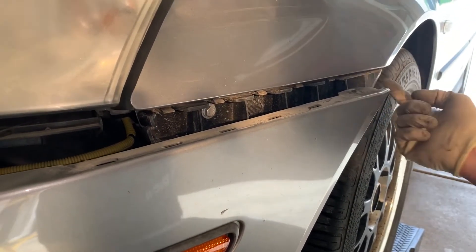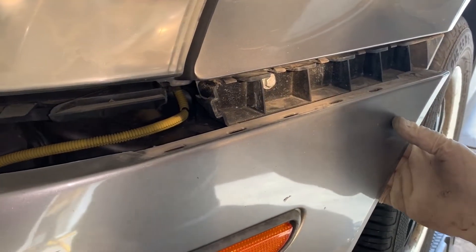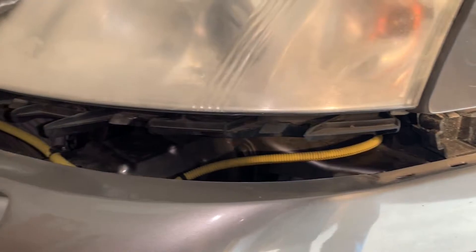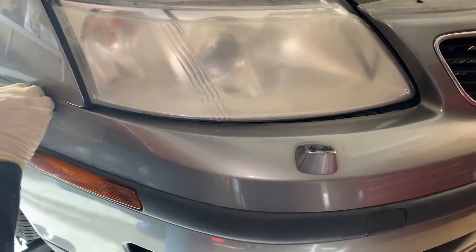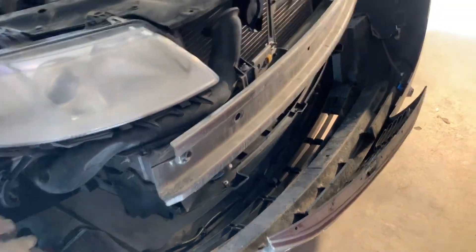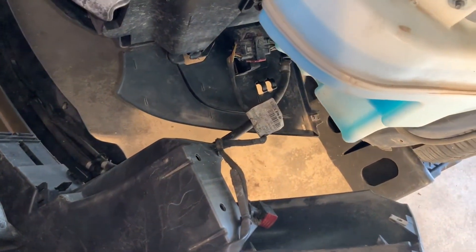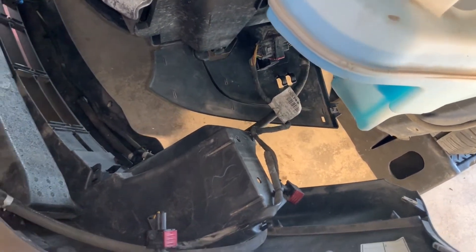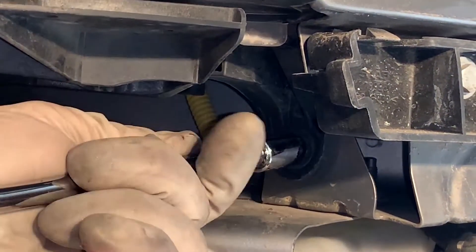This was the screw that was holding it here, and then there are little clips here that are kind of holding it, so you just have to wiggle it out and pull it out. We're not going to completely drop it — we're just going to get access to the bottom of the headlight. There are some attachments here so we'll leave it like this. This is the screw for which we have to move the bumper, so we're going to get this one out and do the same on the other side.